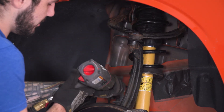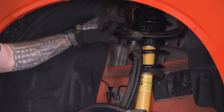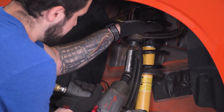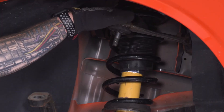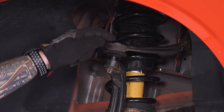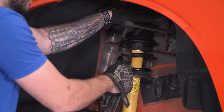We're going to use our 18 socket and swivel to get that nut off the upper control arm. Usually if you haven't touched your suspension in a while, the upper control arm and ball joint will be stuck together — they're a tapered fit, so it usually has to be hammered out. If yours doesn't pop off, thread on the nut a couple of threads, grab a hammer, and start tapping directly on the front. You don't want to hit the bushing as that can damage it. If you're tapping on that it should disconnect — pull straight down, take the nut off, and guide it off.